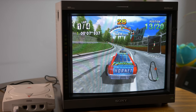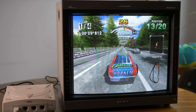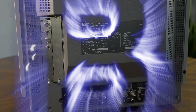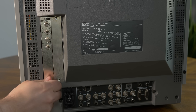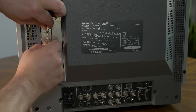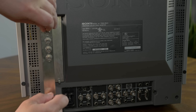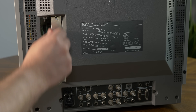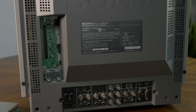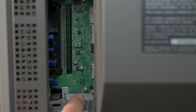Let's check out how I have mine configured, as I think many people will want a similar setup. Installing the 129X Dual is as easy as removing both metal plates in the expansion slot. If you have another card there, you'll need to remove it and put it aside — it's probably an old SDI card that isn't really used for retro gaming. Also, while there are two slots in the back, it's only one input. They were made this way to accommodate a dual-width card, not to add two inputs.